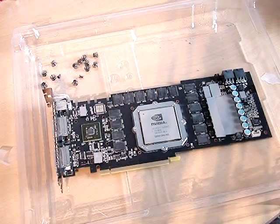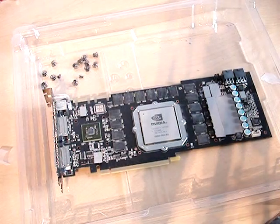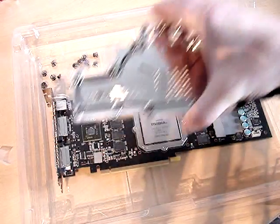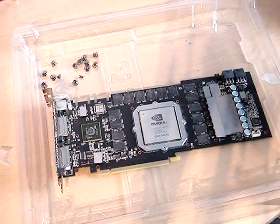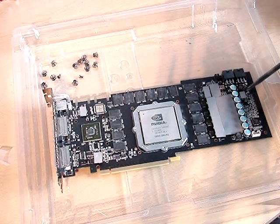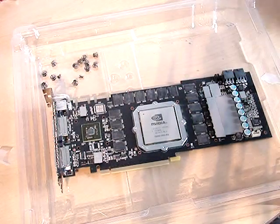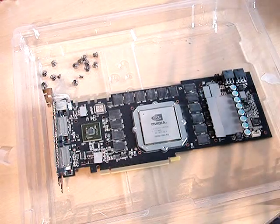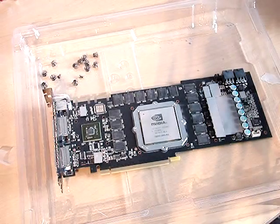After you're done with this, you need to do two things. To install the EK water cooling block, which looks like this — it goes here nicely. First of all, you need to apply thermal pads. This goes in a few areas: you have an area here, one chip here, and two more here and there. You have a few pieces of thermal pad that you cut with scissors to the proper size and apply on all areas specified in the manual.